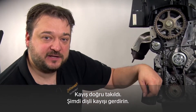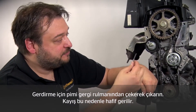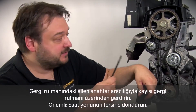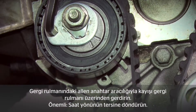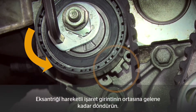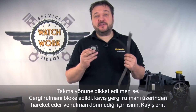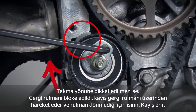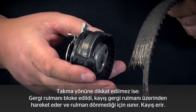Now watch carefully, because we are going to tension the timing belt. To tension, remove the small pin from the tensioning pulley and the belt is then slightly pre-tensioned. You then need to tension the belt correctly via the tensioning pulley, using the hexagon socket on the tensioning pulley. The important thing is to work counterclockwise — turn the eccentric until the moving mark is positioned in the center of the recess. And this is the result if you don't tension in the correct direction: our tensioning pulley seizes, the belt runs over the tensioning pulley, becomes hot because the pulley is not rotating, and the belt then disintegrates.